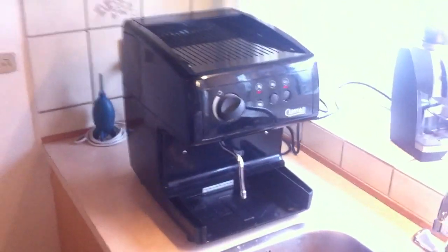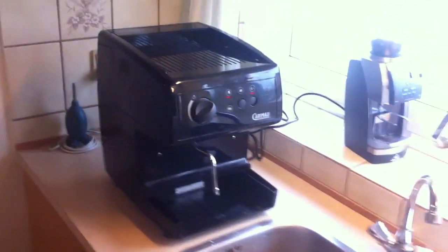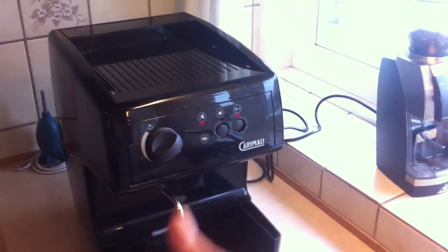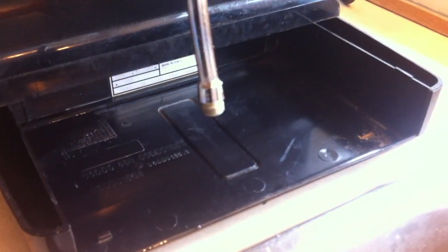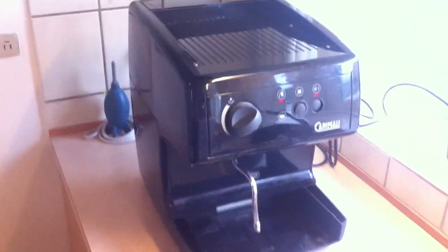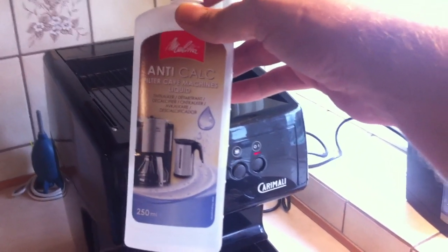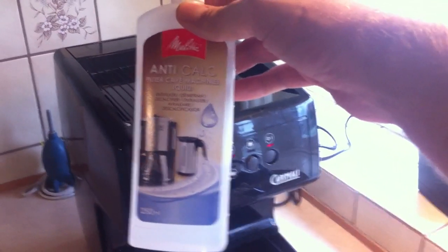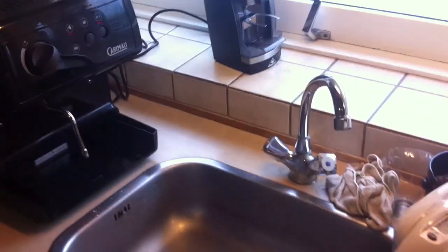The first thing you need to do is empty the boiler. Basically all you do is heat up the boiler so it has pressure, then tip it on the side and empty it out into your sink or whatever. A good idea is to unscrew the steam tip so it's easier to get the water out. After you empty the boiler, you add a descaling solution - this one is citric acid based, a non-smelling descaling solution which you mix with water in the appropriate amount.